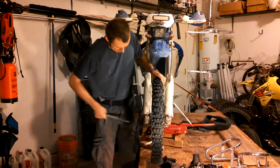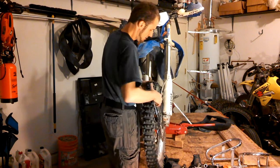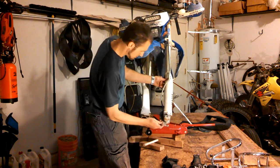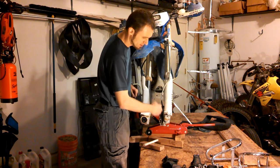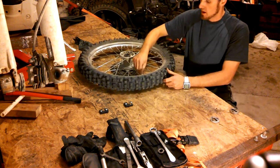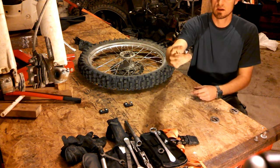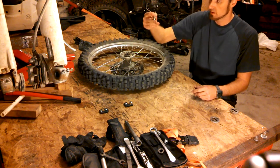I put the rod back into my fanny pack and the wheel is off. At this point I use one of the tire irons to split the brake pads a little bit — because I'll have to put the tire back on so I need the disc brake to fit in really easily. First, the valve has to come off. I always carry this cap that has a valve remover — very important, because if you don't have this you can't take your valve off on the side of the trail. The valve came off and I put it into my fanny pack.